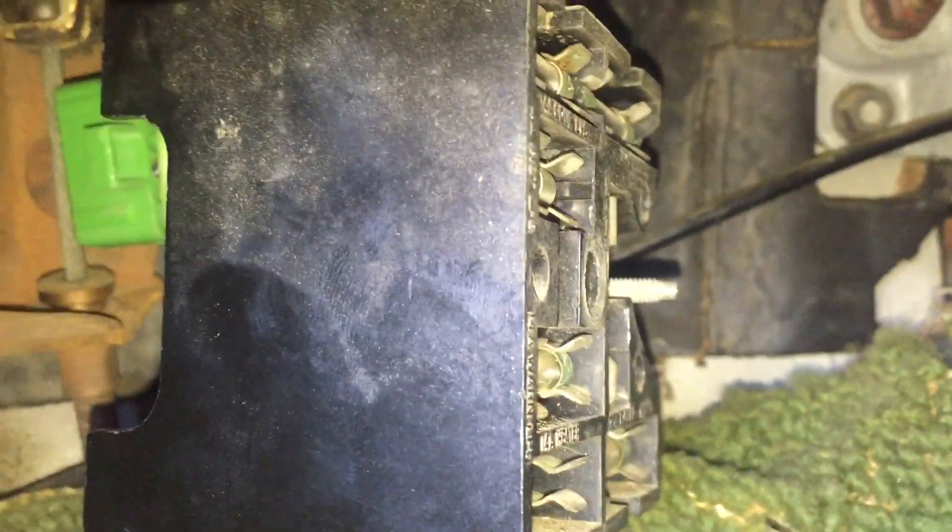Now I'll be able to push it in from the back and just wire it in. Honestly, I'm just hooking up an electric fuel pump right now, so I'm going to use that tab. But I figured while I've got this fuse block apart I might as well throw that wire in, then just heat shrink it off and it'll be ready for when I want to use it.